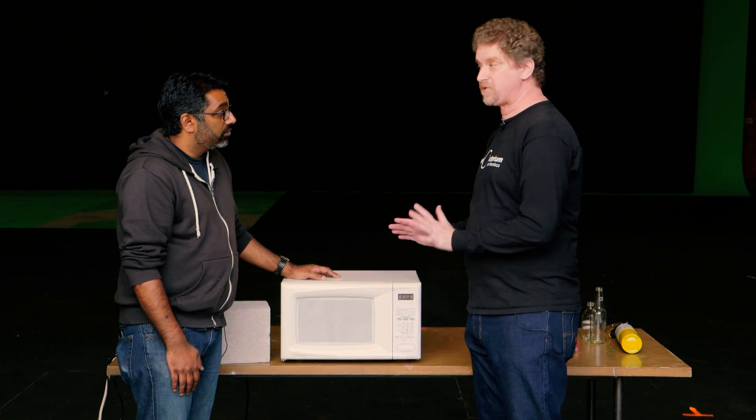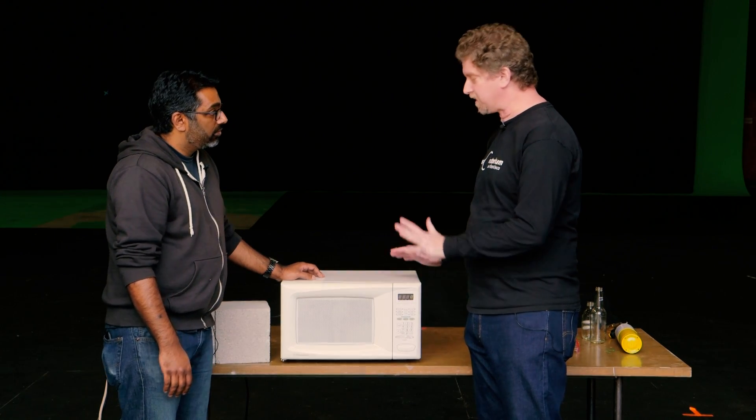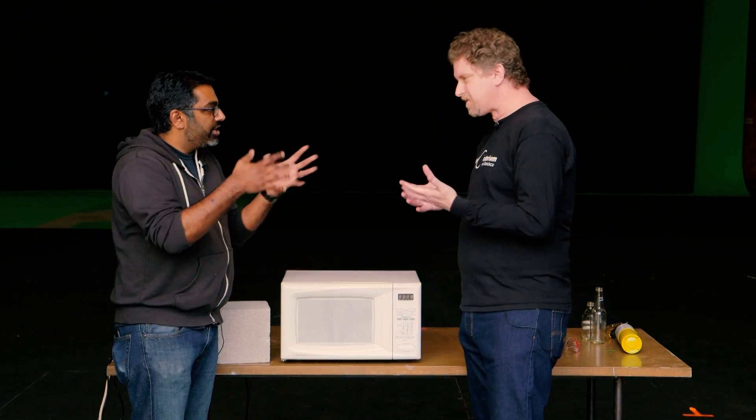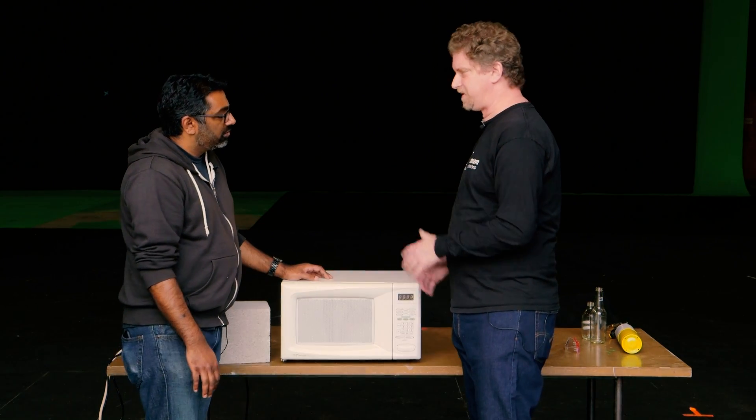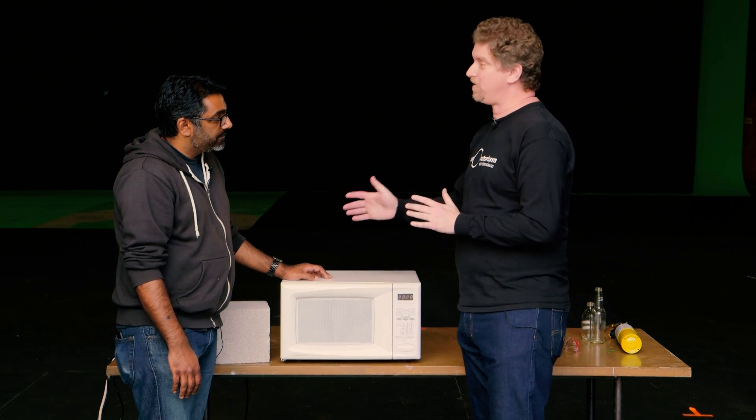Just boil water? So many people think that microwaves are uniquely tuned to make water boil, but it turns out that microwaves are a more general purpose thing than that. The frequency of the microwave is about 2 gigahertz. That frequency drives charged particles — it makes charged particles move back and forth. In water, water has a positive side and a negative side, so it forces the water to move back and forth, and that vibration generates heat through friction on the inside.